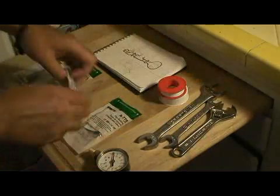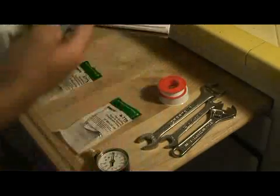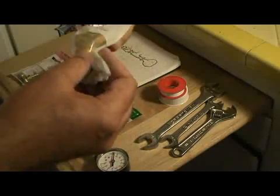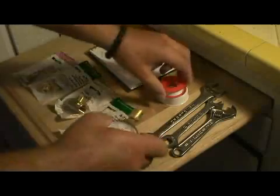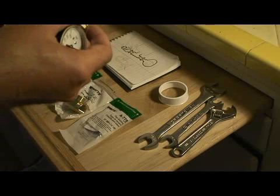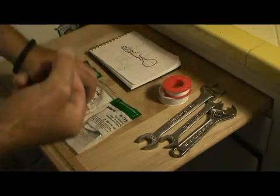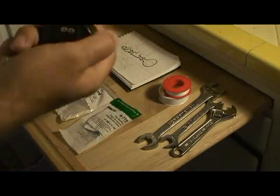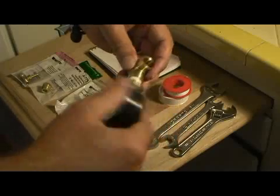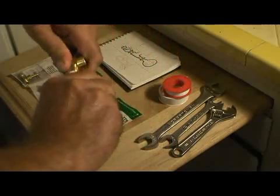Not going very tight enough as it should be. Now this is the T that right in the middle of the portafilter connects to the center part. We'll throw a dab of Teflon tape on the thread — helps with the sealing. And this is a matter of screwing this in here, probably go one more time.